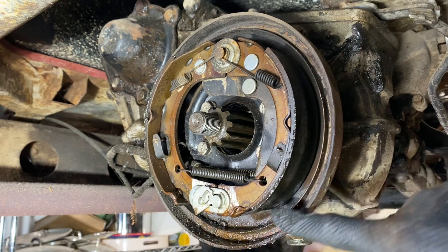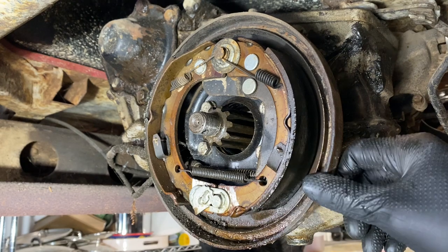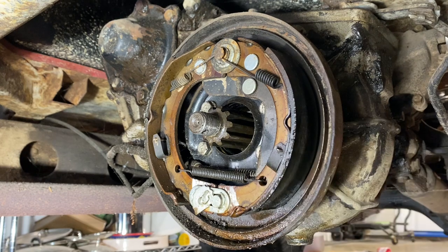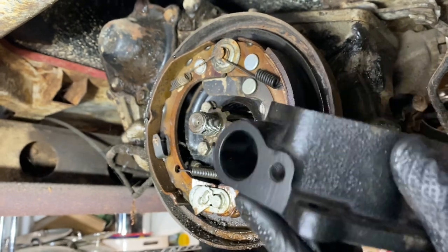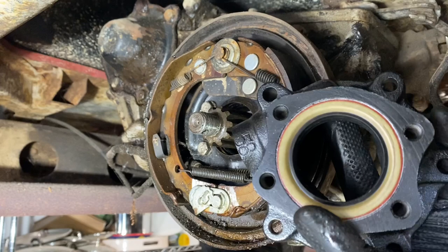As you can see, coated in grease — pads are coated in grease. This is a really common issue when the FJ-40s get this old due to a single lip seal issue on the transfer case output shaft. Today I'll be installing a beautiful dual seal upgraded housing from Valley Hybrids, and we're going to get into how to do this swap today.